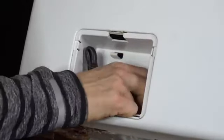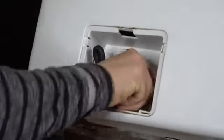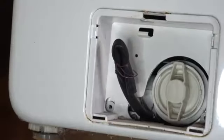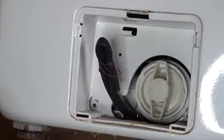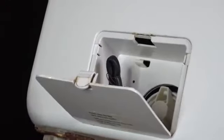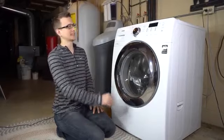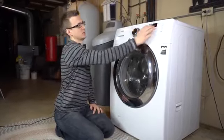You'll feel it. There are little stoppers here that stop it once it gets tight enough, so you can't over-tighten it. Get it all back together, put the door back on, take the washer prop off, and this washer will start to drain real quick. We got the washer down and pushed back in — now let's do a quick test on normal cycle.